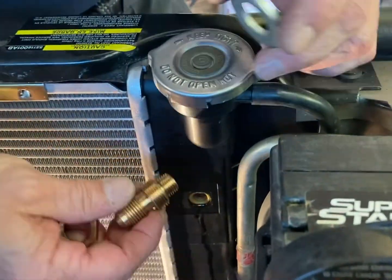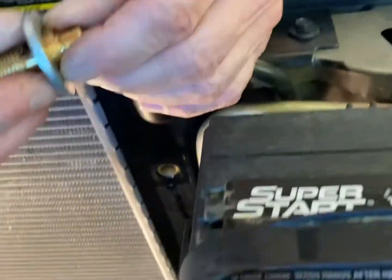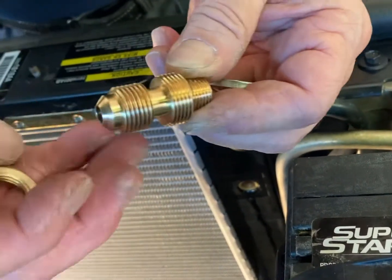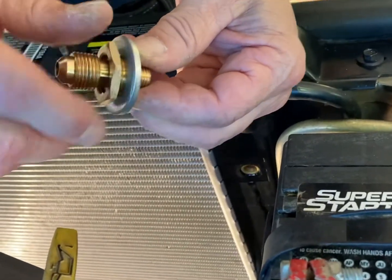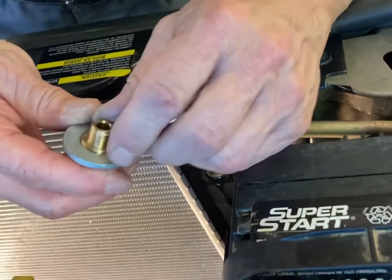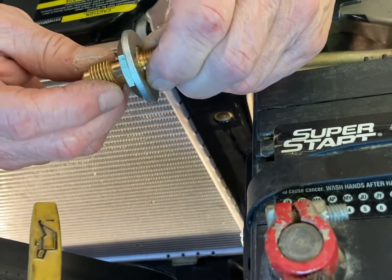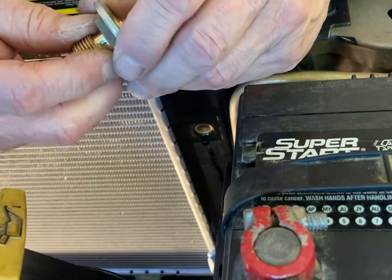Then you have to seal the tank to this body and sort of sandwich it. So you need a washer big enough to go over that and use this nut. Oh, I forgot to tell you, there's a 10mm slot here for holding this thing and turning it. It's machined in there on purpose for that reason. But the only way to get that tank to seal is going to be a bigger washer, and use this same thin jam nut, what we call a jam nut, on there and pull it down. I think I'm going to put some 90-minute gasket maker on the bottom of this washer if I don't decide to do something else. But that's the only way you're going to seal a Mishimoto radiator, at least the way mine came out of the box. So good luck with that. I'd check that first if I ever bought another one, if I ever do.